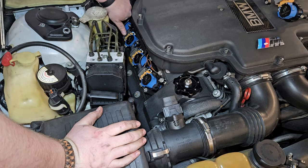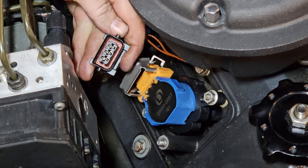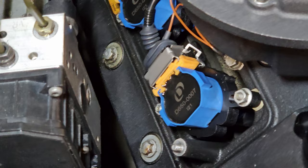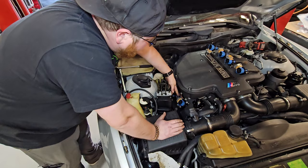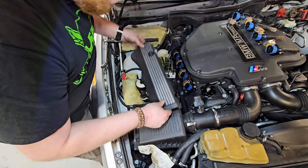Now that you've got all this back together and everything is plugged in — you can think you have this plugged in but it slips and you push it down and think the connector's in there, but it's actually not. So you have to make sure that little notch right there — see these little tabs? Those tabs have got to line up correctly. It'll go all the way in and then you can shove this down. You can see the little thing actually pushes the notches on the side of the plug in. Take your time and pay attention. You can also pull on these — give them a little tug and you know everything is right. You can visually see it too — every one of those notches is where they're supposed to be.